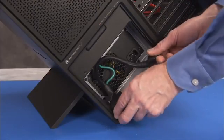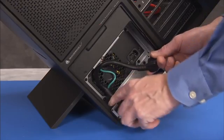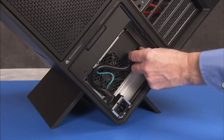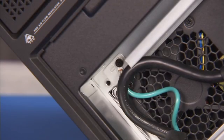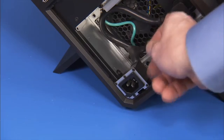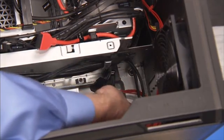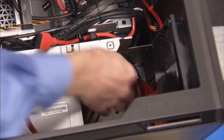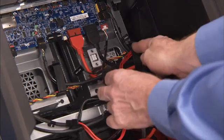To replace the AC adapter cable, first press the AC inlet into place. Replace the power supply end of the cable to the power supply. Replace the Phillips No. 2 screw for the grounding tail of the cable in the fourth stenciled location on the rear of the power supply. Replace the hex screw to secure the AC inlet to the bottom of the PC. Replace the front I/O power connector into the cable guide under the middle bracket of the PC. Secure the front I/O board power connector into the large cable clips at the top of the PC.